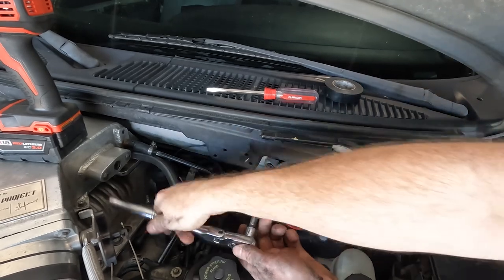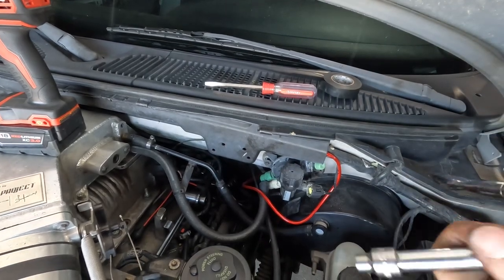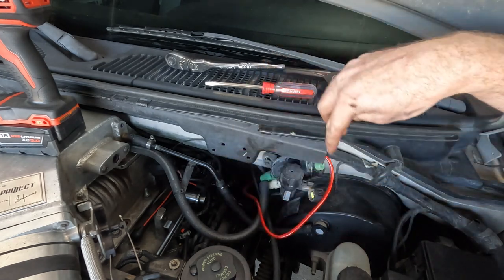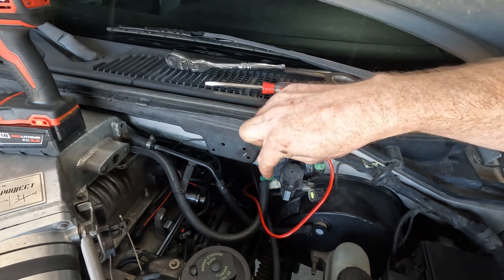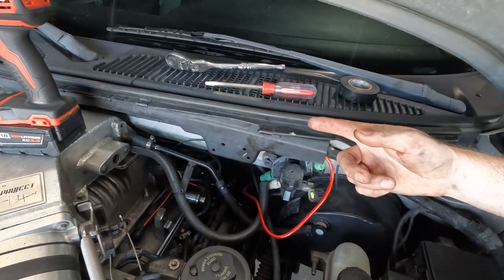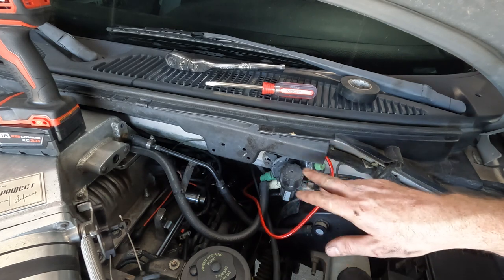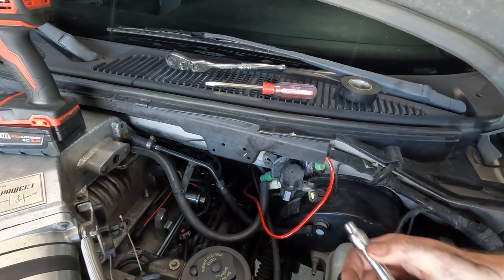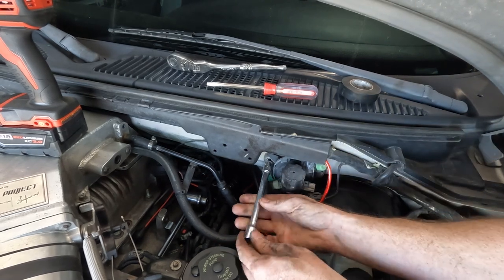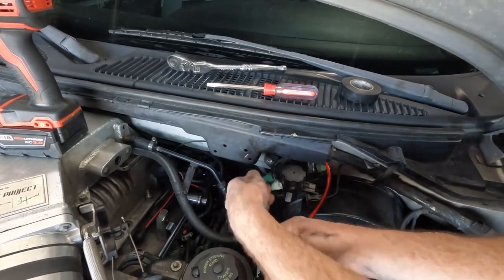Just a little hint: when you're routing your wire, make sure you're aware of any other objects. I passed it through here and got it through the grommet in the firewall. I poked a hole, used that old 10-gauge blue wire, taped the 8-gauge onto it, sprayed some WD-40, and pulled it right through. The old wire didn't even go through the grommet — they knocked the grommet out of place and left a big gaping hole because it wasn't placed properly. We went ahead and fixed that.